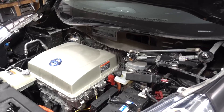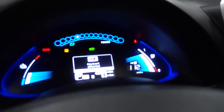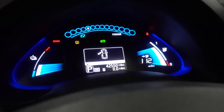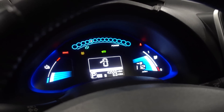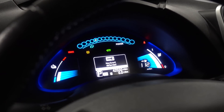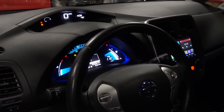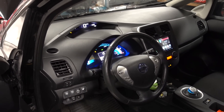And bam, we are done. Before I reassembled everything like the windshield wipers, I thought I'd just fire it up — and I did. Voila, we have no more check EV warning lights! It is now confirmed that the 110 and the 160 kilowatt inverter both work with the same code. I have one warning light on because I just switched to winter tires and haven't had time to sync them, but no EV warning lights — that's very nice. Now I can reassemble the last bits and take this for a drive.